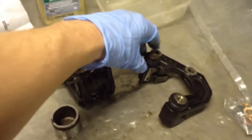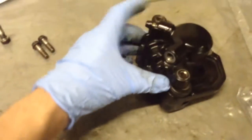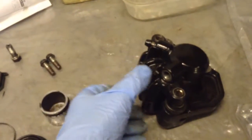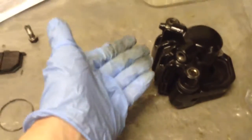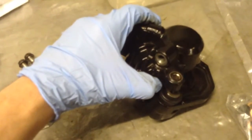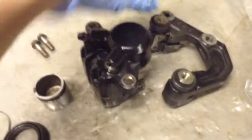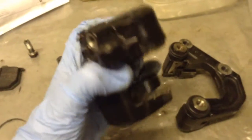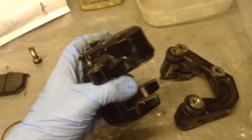If these sliders are stiff in any way, that can stop the system operating properly. The way this works is that when you've got the pads in there, that sort of bolts onto there. So the piston, obviously pushing down through there, will push the piston-side inner pad towards the disc. And then as soon as it's gone as far as it can, the whole thing will pull the outer pad towards the disc.